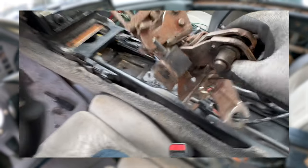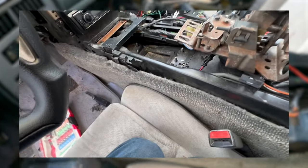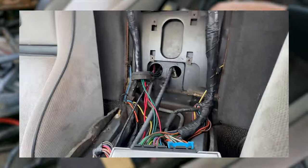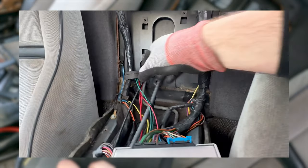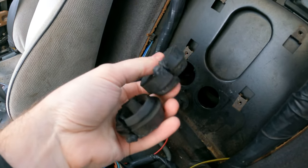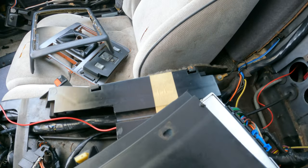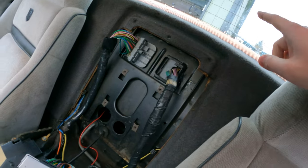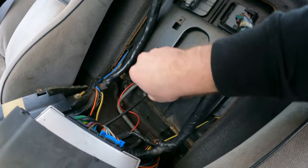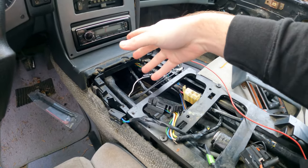I have a video actually pulling out the shifter and taking that out so you can see it. The shifter cables go under the skeleton. You have to remove the PCM, and then there's two grommet holes. From there you just cut the grommets — it looks like the previous owner already did this, so that saves me a little bit of time. From there, pull it out from the engine bay area — just pulls right through. Actually way easier than I thought. And then once those are removed, you can just easily unbolt the shifter and take it out.